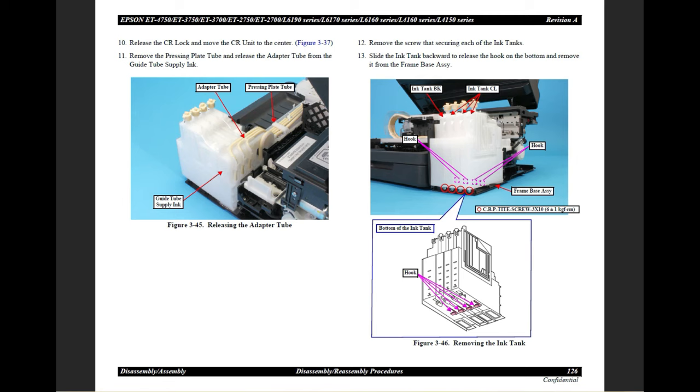Here's a picture of the tank. You get your refill plug here. You can remove the tube without taking the cover off. The next step is remove the tube and then you can blow air or inject something to make sure the liquid is coming out of the tube — it's pretty easy to unclog if the blockage is inside the tube. After that, your best bet is there's an air hole. You got the ink coming from the refill hole; here's where the printer keeps the ink. On the top you can see a lot of channels. Sometimes when you move the printer, the ink gets into the channel then dries there — there's no air coming in. That's what caused the vacuum inside the tank.